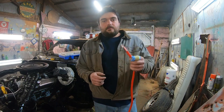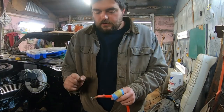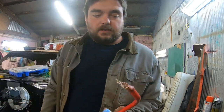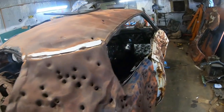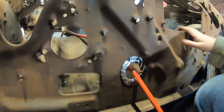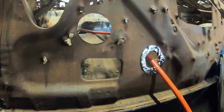All right, so I made a discovery — these jumper cables actually come with lugs pre-installed. So I'm just going to take a piece of heat shrink and seal the connector here. That's going to be the starter end, then we'll run all the way back to the trunk with the other end. So what we're going to do is run this battery cable up through the inside of the car, through here, and then we'll go through the old speedometer cable hole and that'll dump us out right by the starter. The boy made a little grommet out of some Dynamat stuff, so hopefully that won't saw through the battery cable and kill us.